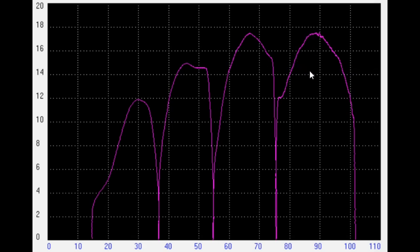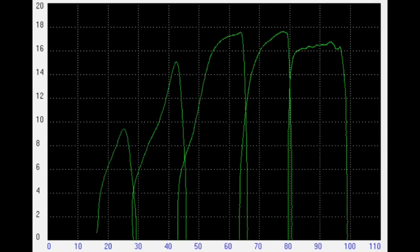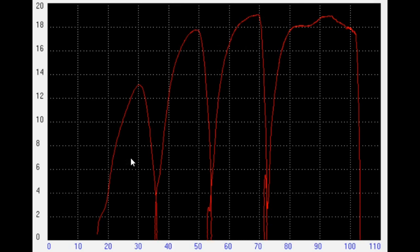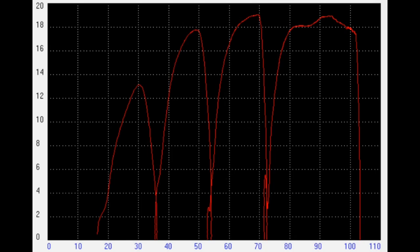Compare that to the T5 and PX125 gearboxes — something like a 5.6 final ratio. They're very little gearboxes but they can also be tamed by changing the small sprocket on the clutch and bringing them more into line around the 5 region. Either way, the spacings on the P200 are quite ample — it's just a very low final drive ratio which often needs adjustment. But if you have a torquey motor like a Polini touring kit with a SIP road exhaust, or a Pinasco kit with a BGM big box, that will pull P200 gearing all day long and make for a fabulous mile-munching cruising machine because of that low 4.6 drive ratio in fourth gear.